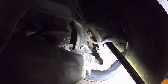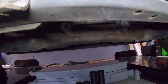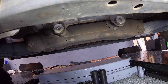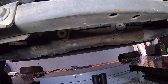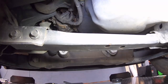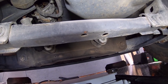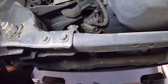When we do the hub replacement, we'll need to inspect the ball joints and make sure we don't have to replace those while we're in there — no better time than when the wheel is already disassembled. The nice thing is this is a two-wheel-drive 1500, so we don't have the front diff to deal with. All we need to do is take out this center bar and we can drop the oil pan without having to jack up the engine, which makes some operations easier.